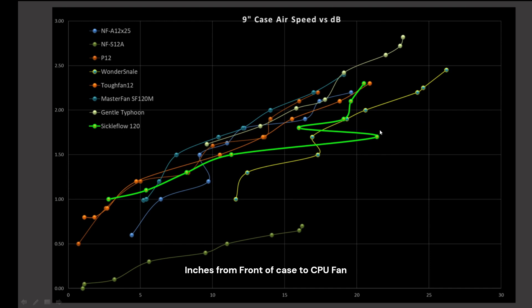Then there's this joggle off to the side — this joggle is literally a harmonic. It's where I hit a key frequency within the fan where it gets really noisy, and then once it gets past it, it gets quiet again. Luckily the fan only has one harmonic that I could find. Unfortunately, it's at around 60% PWM fan signal, which is a key PWM level in a lot of applications because as you need to ramp up fan RPMs to keep things cool, 60, 70, or 80 percent are probably the key spots for not getting too noisy.